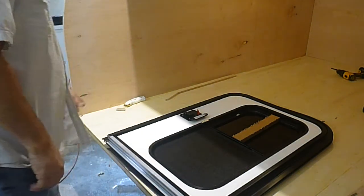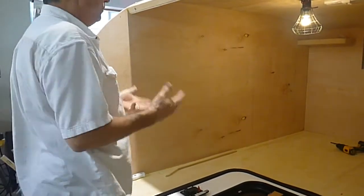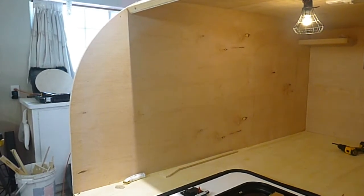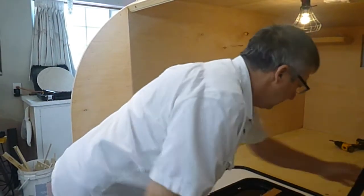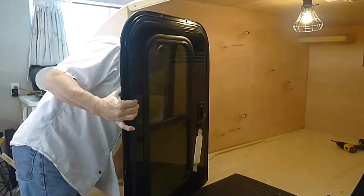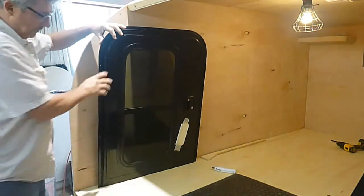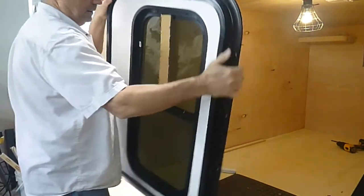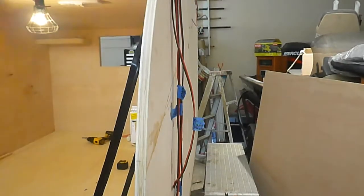Installing a store-bought door. I haven't cut the hole in the side yet because I didn't have the doors yet, so I went ahead and got as far as I could get. Now when you get the doors in, you think you'll just lean your door up against here and trace it out. Well, that'd be good, but don't forget — you have an overhang on the bottom which is going to go up against your side, right down here, and hang down a little bit for a good seal.